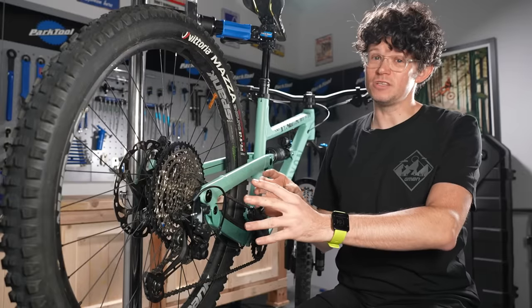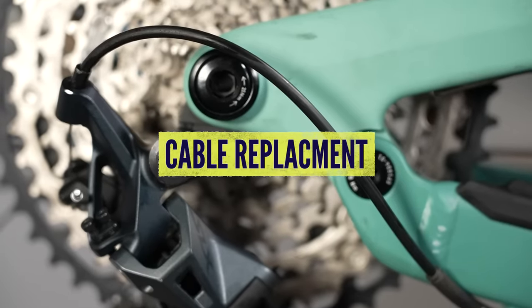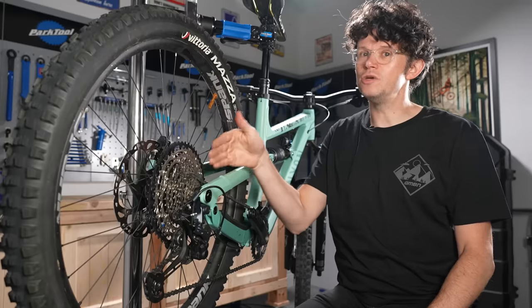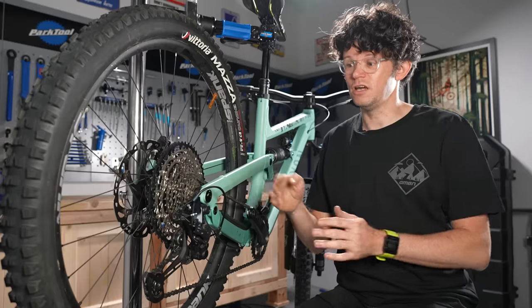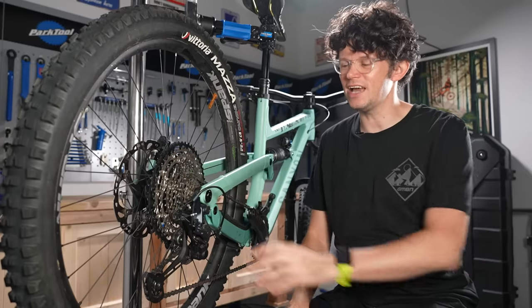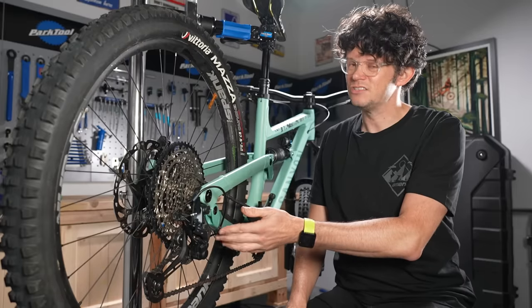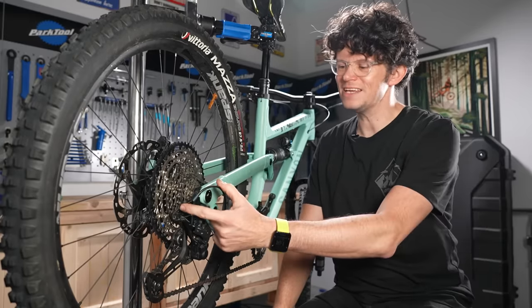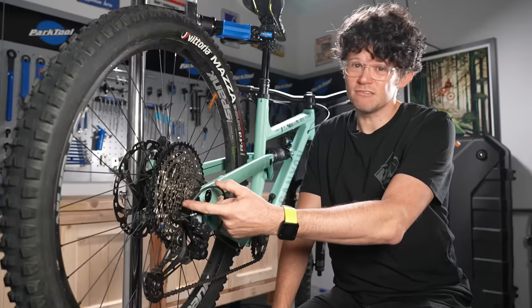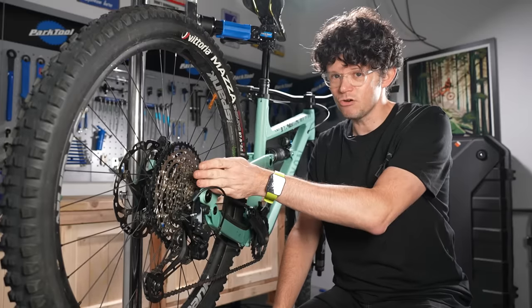If you've tried this step-by-step process and your gears are still a messy nightmare, there are a few things it could be. Even after playing with your tension and adjusting the barrel adjuster in and out, if it's still really sluggish on a downshift only and quite hard to push the shifter and the mech up, it's most likely a gear cable. Have a look at the gear cable itself — are there any splits or cuts on it? Because if there are, that's probably why your shifting isn't going to work. If your outer cable looks okay but your bike's seen a lot of use, it's probably the inner cable — they can rust, they can get crud inside the outer cable, and that will degrade the shifting. You'll especially notice it on the way down the cogs.